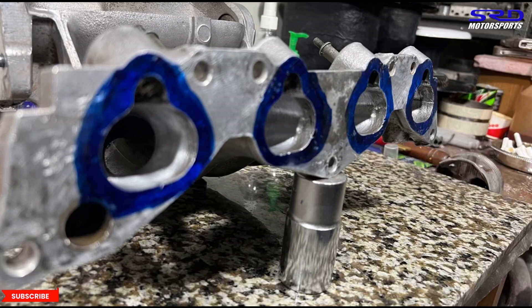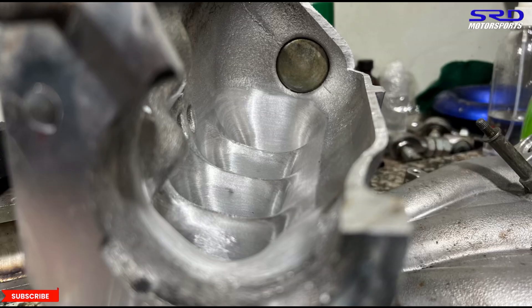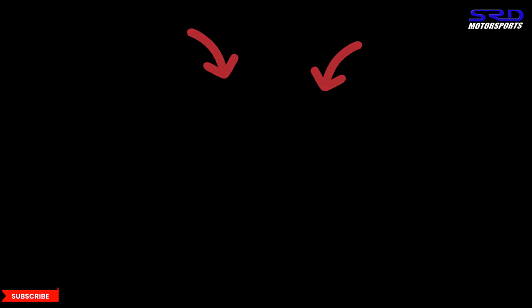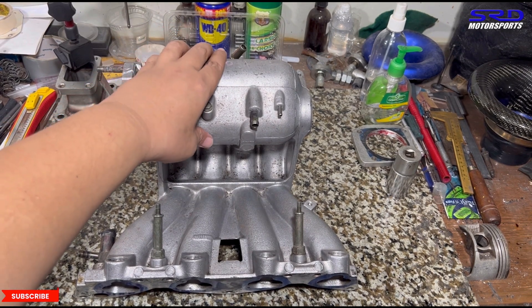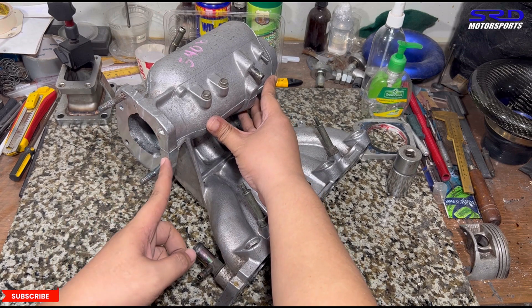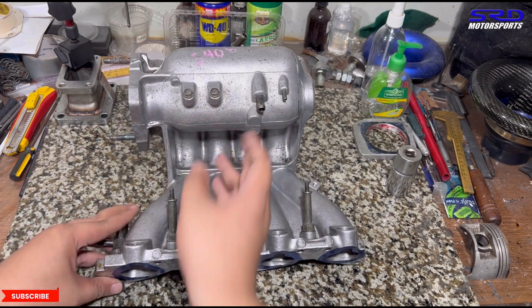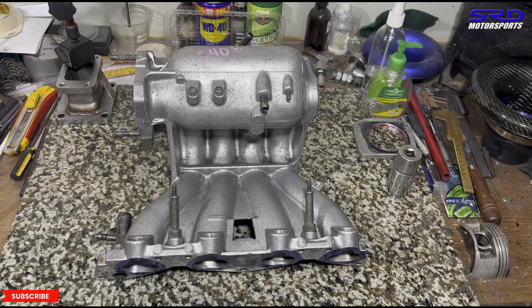In the snapshots you can see it's waiting for port matching — the finish is good on all sides, and you can actually see the velocity stack shape right here. All this needs now is the plenum welded shut, and once the cylinder head arrives we'll port match it correctly to that specific head. All the videos mentioned earlier will have links in the description below, and at the end screen you can click on the P08 manifold porting video.